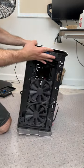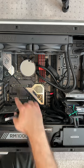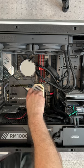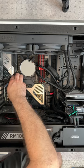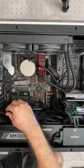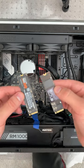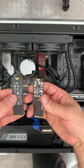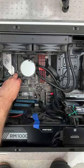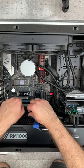With the SATA drives out of the way, I can now tip this thing on its side and take a look at the NVMe drive next. My motherboard is an X570 Tai Chi by ASRock. On this board, I need to remove these three screws to reveal the NVMe drives. One of the screws I already removed held the NVMe drive in place, so all I have to do is pull it right out. The new drive is 2TB and costs less than half as much as the original Samsung drive that was 256GB — putting it into context is a little depressing. My first MP3 player was a little expensive and it was only 512MB. I'm removing the tape so that the cooling pads contact the NVMe drives directly, and then I'm going to screw the plate back in place.